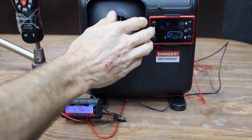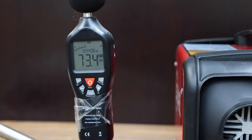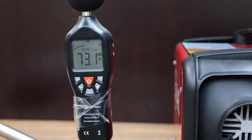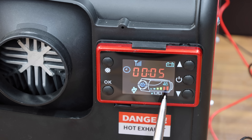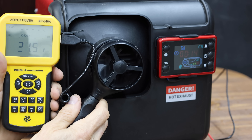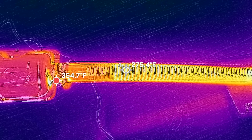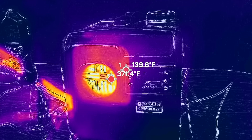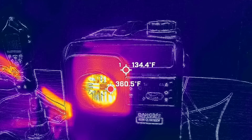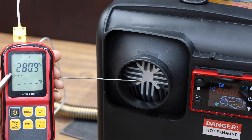There's a lot of smoke coming out of the exhaust while this thing is warming up. No worries — the shop is very well ventilated and I have a whole house fan pulling all the exhaust out. Once the unit warmed up, no more smoke. I will properly ventilate the exhaust before we get into some serious testing. The sound meter right next to the heater reads around 74 decibels — not too loud. The Civil is fully warmed up in only about five minutes. Now that it's fully warmed up, it's holding steady at around 47 watts, and the Civil is moving air at very close to 34 miles per hour. The exhaust is very hot at around 350 degrees Fahrenheit, and the heating element just inside the air outlet is very close to 375 degrees Fahrenheit. On the highest heat setting, the air temperature in front of the vent is very close to 280 degrees Fahrenheit.